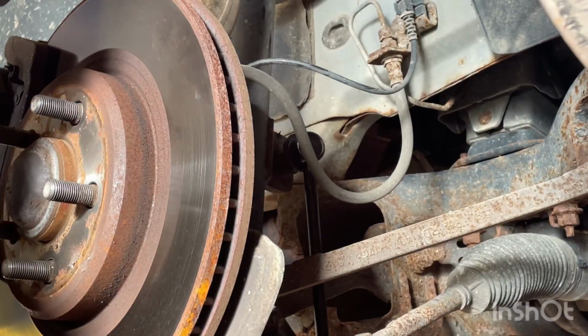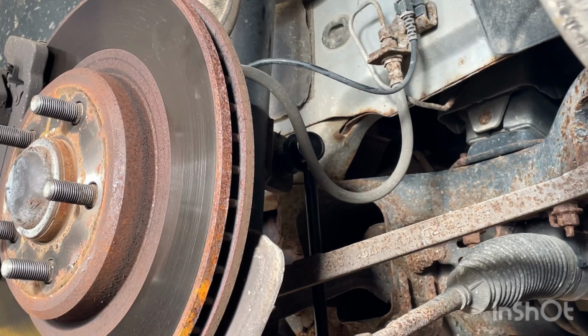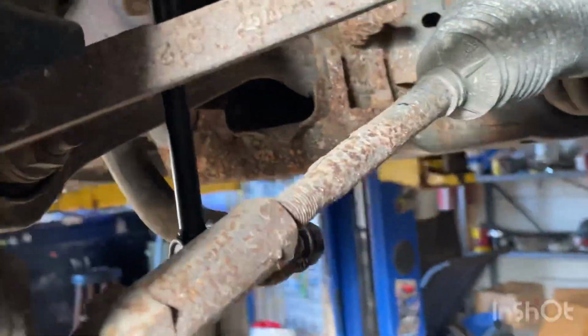All right. And then we put our nuts on, and then we tighten them up. I just dropped that nut. And we're going to tighten these up by hand. They bottom out against each other, so once it gets tight, give it a good oomph. It's nice and tight. All right, that'll do it, guys. Thanks for watching. New sway bar links.